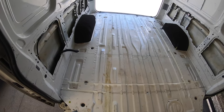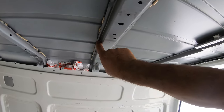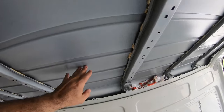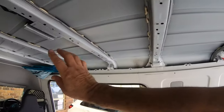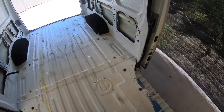I'd rather have extra battery power than not enough. I'm going to put the MaxAir fan around this area — I've got to chop a little bit of the roof support to fit it in. A lot of vanners put them in the wider spot, but I'm coming over here because putting it there would interfere with my solar panels. I can put one panel behind the fan and two in front. It's a lot on your mind — your mind's always ticking over even when you go to bed. Anyway, the insulation I'm going to use is called Metalin — it's about 10mm thick, available on a roll at Bunnings for about 300 bucks.